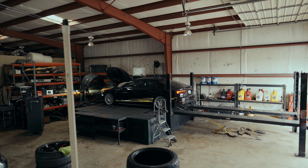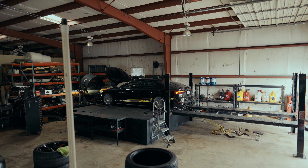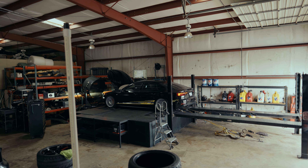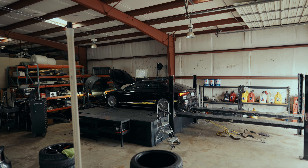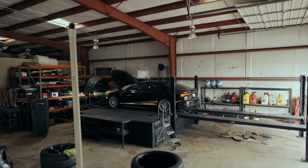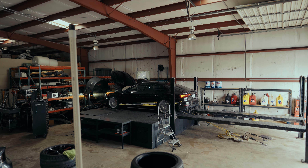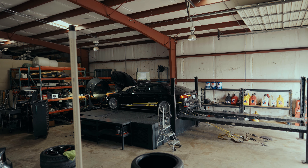Keith has just done three pulls in fourth gear, just due to speed, which is going to make less power because the one-to-one on this transmission is actually sixth gear. So we're going to do a fifth gear pull. He feels comfortable doing that, so he's going to let it rip, and it should make — hopefully — over 500 wheel torque.